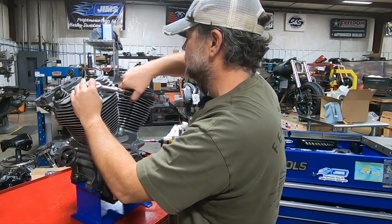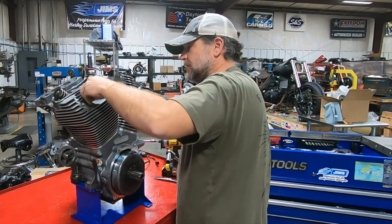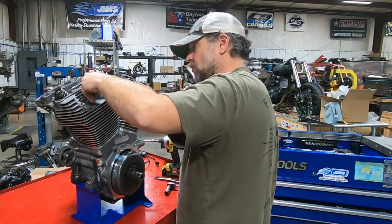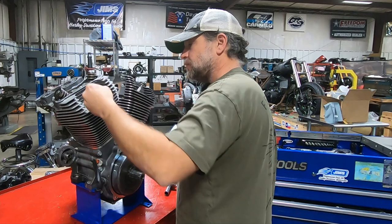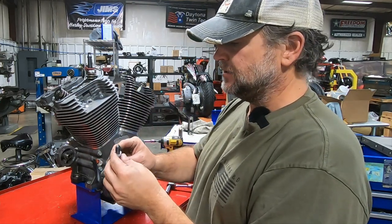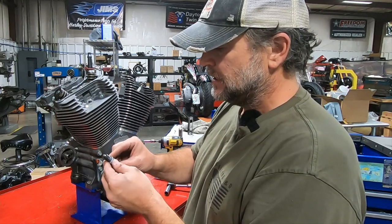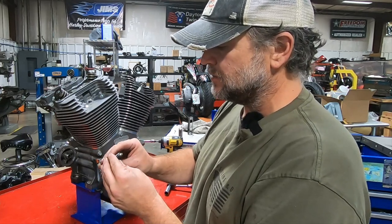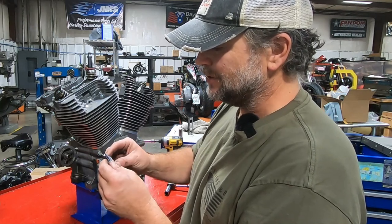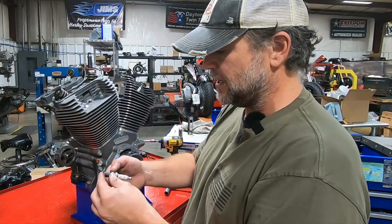The plugs are going to tell us how well it was running and give us a clue as to what we might find inside. He's running stock 6R12s, which — or an Autolite equivalent — is perfectly fine. The plugs actually don't look too bad at all. There's not a tremendous amount of oil fouling. The gap looks about right, the center porcelain looks good, it's bright white. I see a couple of little specs — maybe had a little bit of detonation — but nothing too bad. Actually looks pretty good.